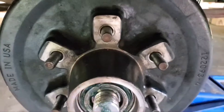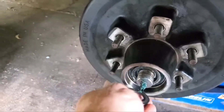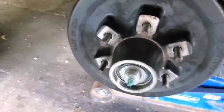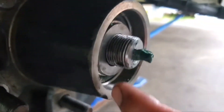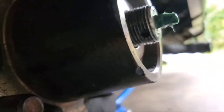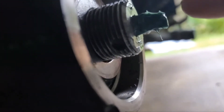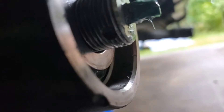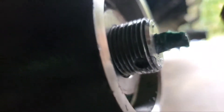I'm pushing the bearing in. Next is the washer, and then the castellated nut. However, do yourself a favor and find out where your hole is in advance. Unlike most times when you use a cotter pin with a castellated nut, the hole is not centered — and it's not centered because the grease fitting and the shaft, allowing the grease to travel into the hub, is down the center, so the hole is off to the side. It's a good thing to make note of.